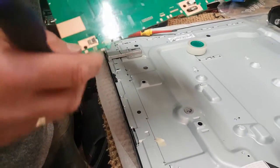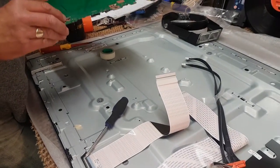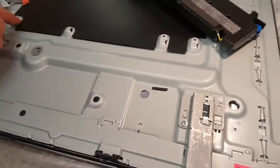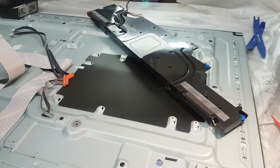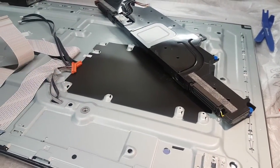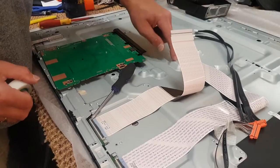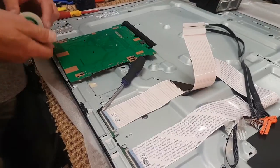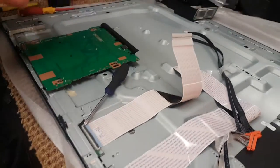That's not coated at all, is it? The copper is there for a reason — is that earthing to the chassis? Yeah, is that going to cause a problem? There are some bits of tape on the one I've just done. I'll scrape it so it can make contact — we've got conductive grease. I think it's mainly these bits that kind of earth it. That's not going to earth anything there, but where the clips are I'm just going to protect.